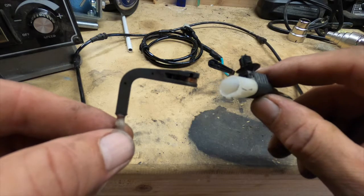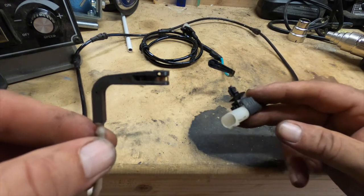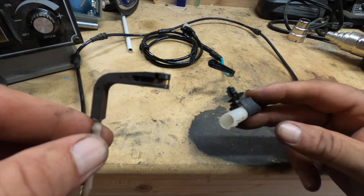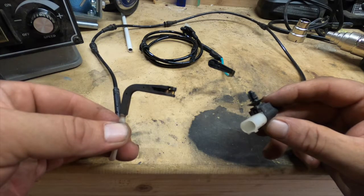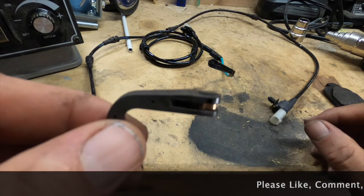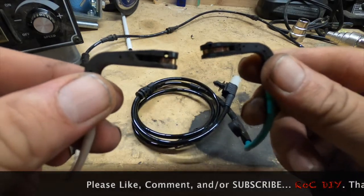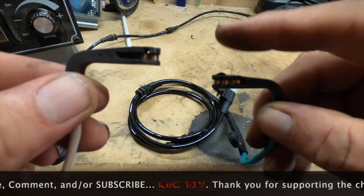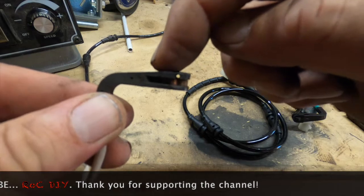What I have here is a brake pad wear sensor cable for a 2016 Land Rover LR4 HSE. In most cases these sensor cables are going to be pretty similar on the majority of vehicles that do have them. This is the one that came off the vehicle and this is the one that is new. If you look at the top of this one it's got a nub, and if you look at the top of this one it's smooth.